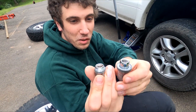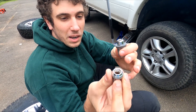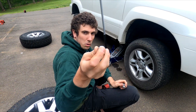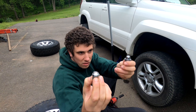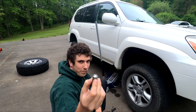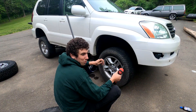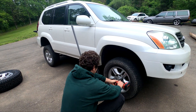This one has a square taper. This is what they call an acorn 60-degree taper — most aftermarket wheels are going to use something like this. But you're not supposed to use this on this type of wheel, so unless you actually change to an aftermarket wheel where this is acceptable, it's a safety concern. Thanks kid — that's my Mother's Day present. She got so sick of hearing me talk about shoulder tapers on lug nuts.